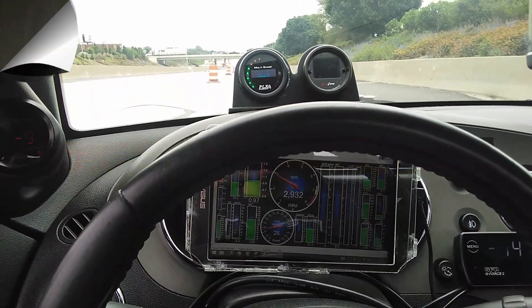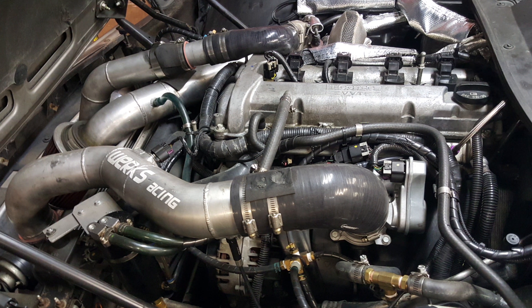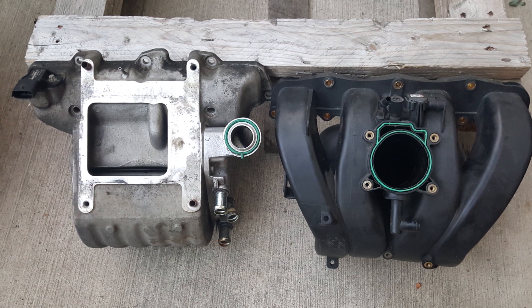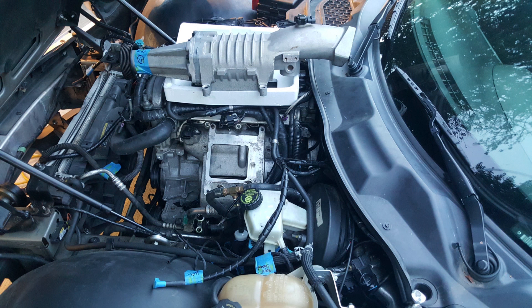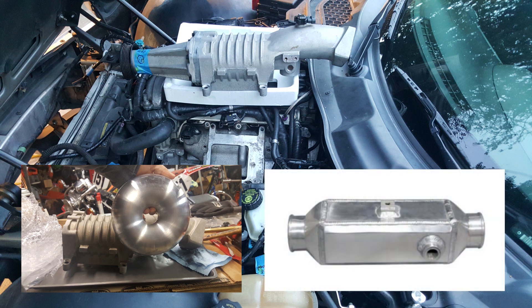Here's the car in the original form that I got it, with the tubing and the turbo kit. You can see some rubbing action at the turbo outlet — it's kind of smashed against the valve cover. Here's the LSJ supercharger intake versus the LE5 plastic intake doing a mock-up, kind of proof of concept. The problem is the throttle body of the supercharger is inside the firewall, which is why I have this super tight radius three-inch donut. I'm doing that because I want this air-to-water intercooler to go between the radiator and the engine up front.